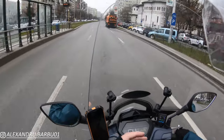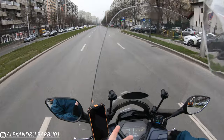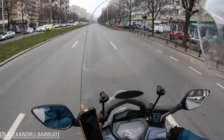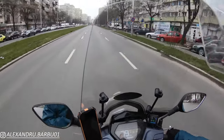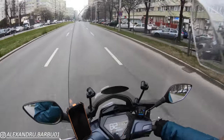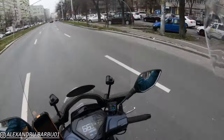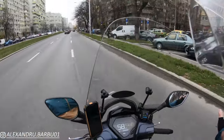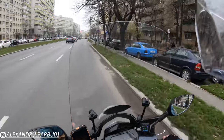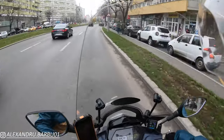What this means is that the tire deforms at higher speeds — say above 50 kilometers an hour — leading to excessive wheel wobble. But the Michelins, being stronger, hold their shape a lot better. Meaning that if you take your hands off the handlebars, even over bumps, nothing — dead straight. You can change lanes and control the scooter just with the weight of your body.